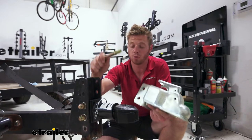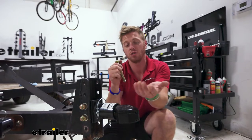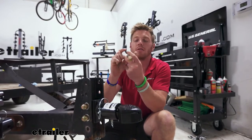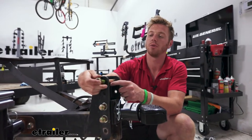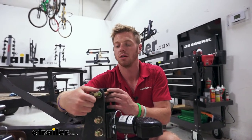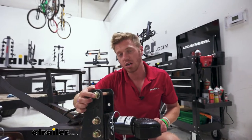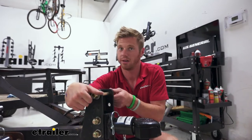It is only going to come with one. It's going to come with one nylon lock nut and then two little washers. A washer is going to go on one side like this, you're going to stick it through your coupler, and then put a washer on the other side. Then just torque this down to the specs of whichever coupler you are installing. All you need is a 24 millimeter socket for this side and a 24 for the other side.